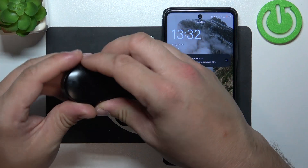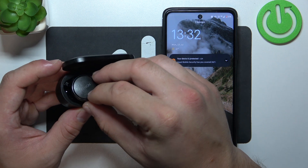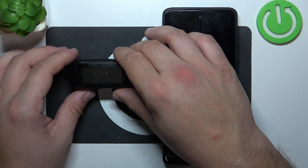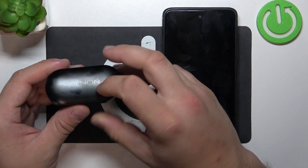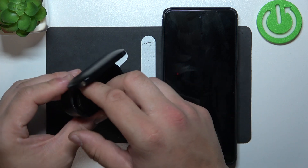In the beginning, place your earbuds back in the charging case and close the lid. Wait from 5 to 10 seconds until your earbuds are fully off. And now open the lid of the charging case and remove them. Soft reset has been performed.